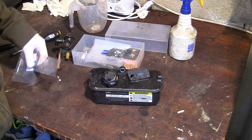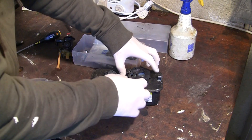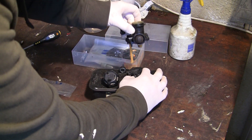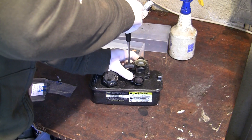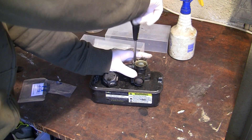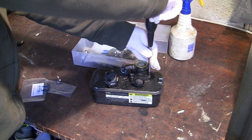I've got an extra diaphragm on there now. I'm putting this back on — I've checked this is running alright already. Even though I've done hundreds of these I still struggle to get it the right way around. Make sure the little spring is under here — that spring is designed to bounce up and down and vibrate, which is what pumps the fuel through the diaphragm and into the carb and engine. I'm thinking it might be too thick with two diaphragms, but if it works it works.